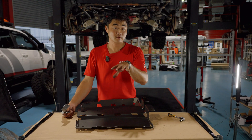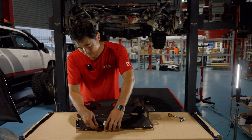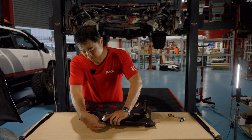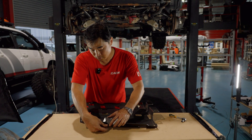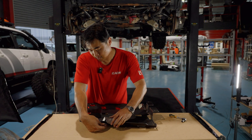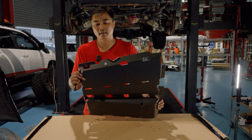We need to do a bit of prep first. Grab the sump guard and we're going to install this little oil ramp. There's a nut set on the back of it already. Grab the little M6 bolts and we'll get that installed — what this helps with is it means you don't need to take your sump guard off to do an oil change. Let's tighten that up.